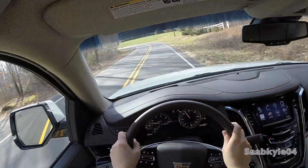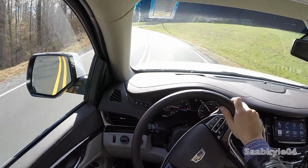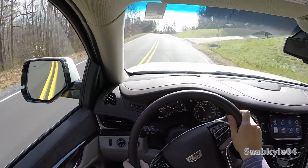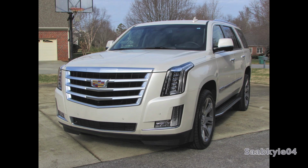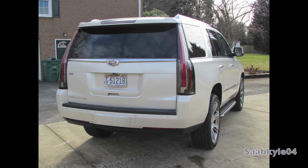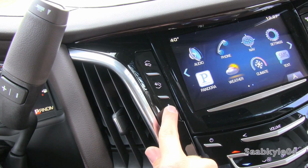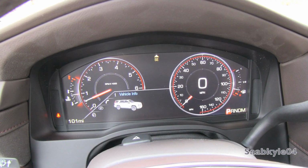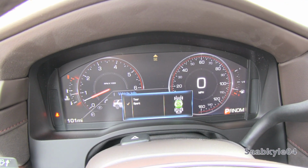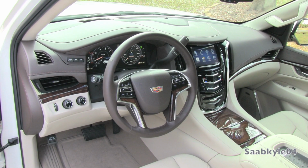The biggest advancement in ride quality are the standard magnetorheological adaptive shock absorbers, optional on the Tahoe and Yukon. Featuring a new dual electric coil design, it allows for near instantaneous shock adaptation for varying road conditions to help maintain a steady ride. 2 driver adjustable modes, Tour and Sport, allow for either a more comfortable or dynamic-oriented stiffer ride on demand.